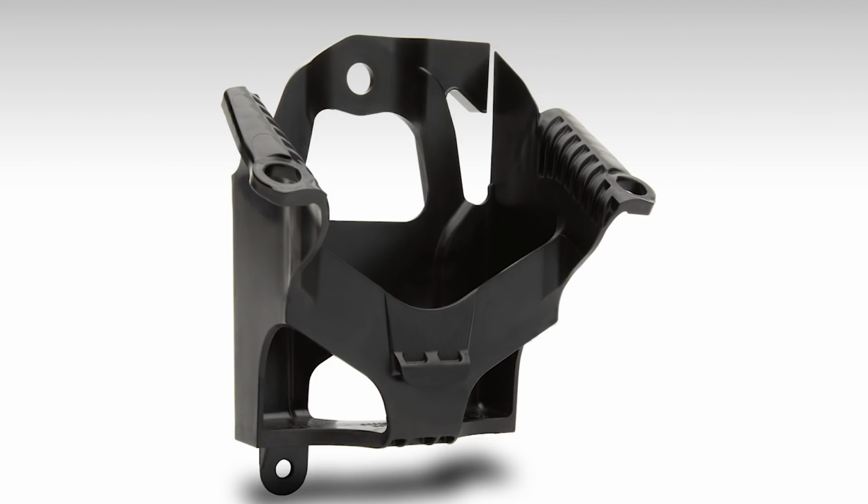The rear brake has a shorter hose and a longer, lighter pedal, as well as new pad material for improved power and better durability in muddy conditions. They've also eliminated the lower rear brake guard like they did on the 450, which reduces weight and improves cooling. New graphics, it's red. It has a little bit more of a traditional Honda look to it. So that's basically our list of updates.